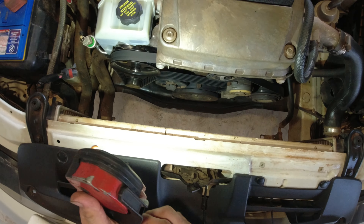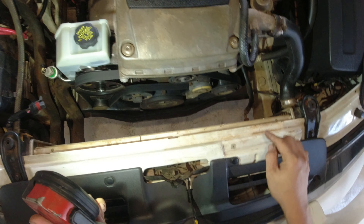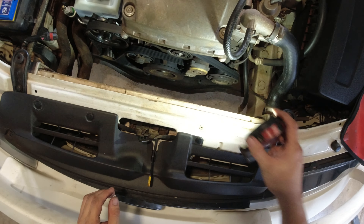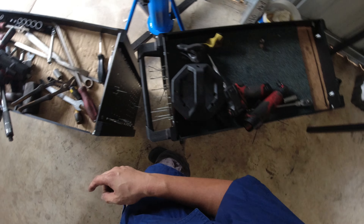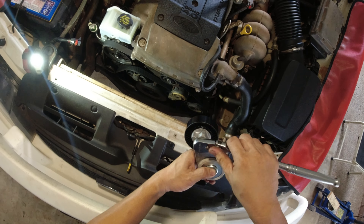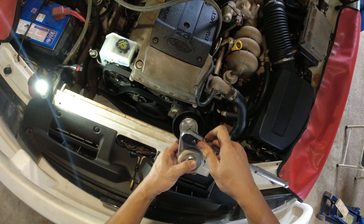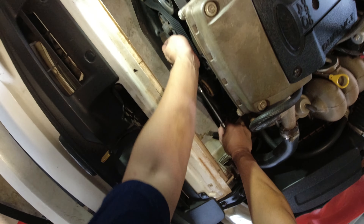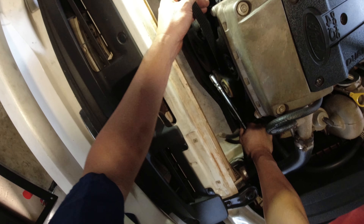Okay, there you go. Why are we replacing this? Because the tension of the drive belt is not quite strong anymore — it's creating a squeaking noise, and sometimes the power steering is quite hard because the belt isn't tensioned enough. You can see this tensioner is not quite good already. But we'll put the new one in later and you can see the new one isn't loose like this. Okay, now we can see the tensioner.